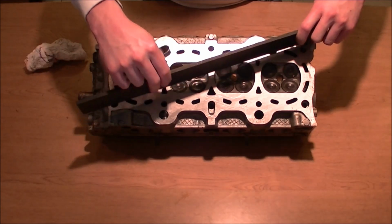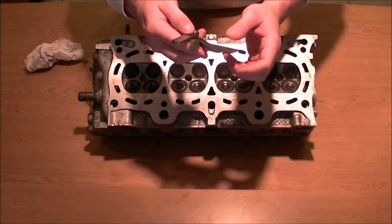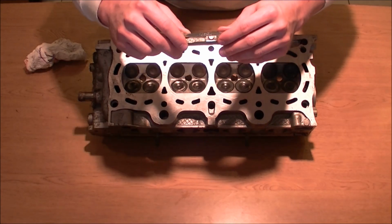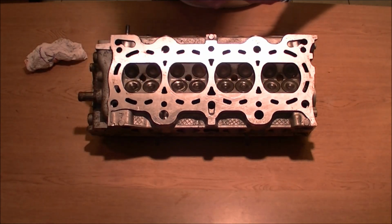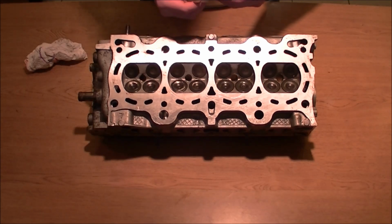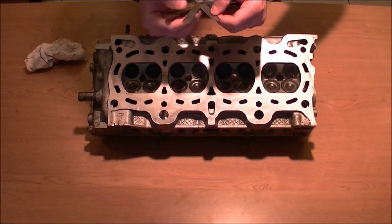And before this, we're just going to take these feeler gauges. You can get them at Sears. This is a Craftsman. If you want to know the part number, it's Craftsman 40811. That's the part number for these feeler gauges. And for this particular head, it requires no more than 2/1000ths. So I'm going to put a 2/1000ths under there, and it tells you right on these feeler gauges the numbers. So here's 2/1000ths of an inch.